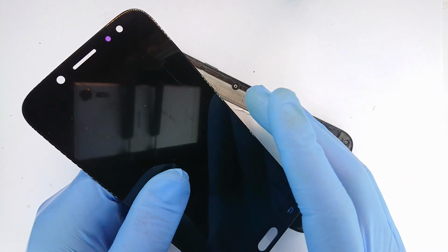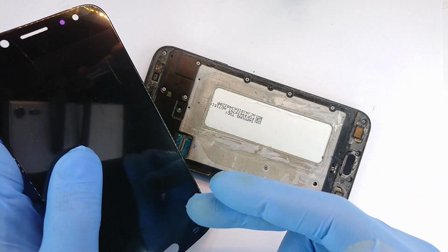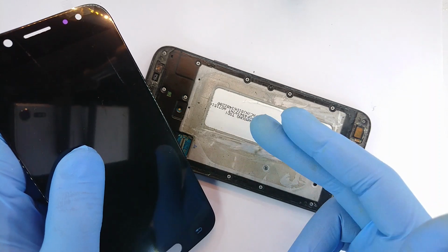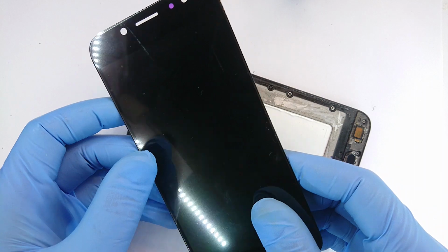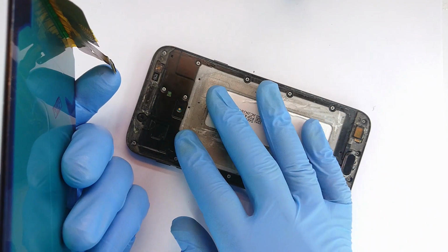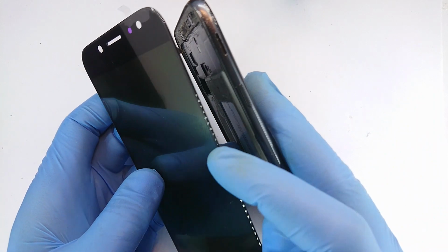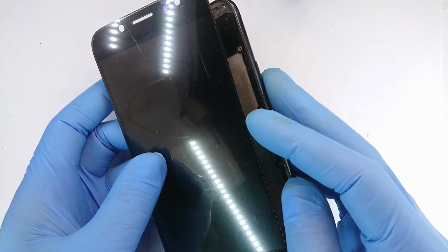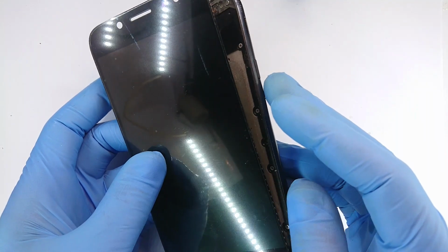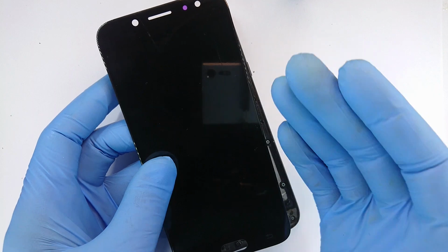That's the AMOLED or OLED version that has same or close to the same color reproductions as the original screen. And then there is an IPS version that was designed to be compatible with the screen, but it's very frail. First of all, when you place it down flush with the frame of the phone, it makes it raised and susceptible to cracking at the slightest of falls because there's no supporting framework at the bottom of the glass.